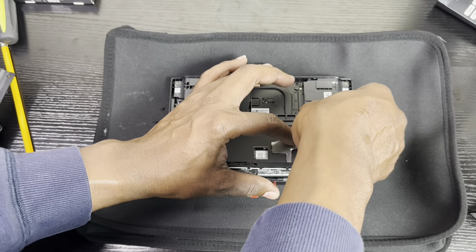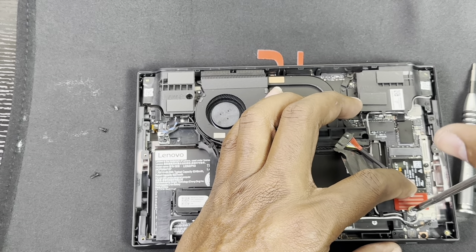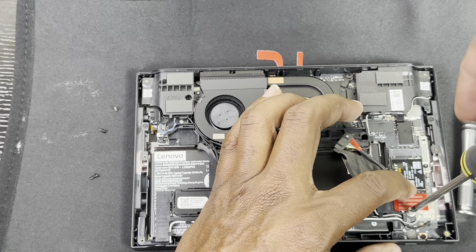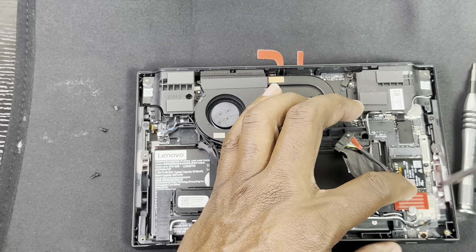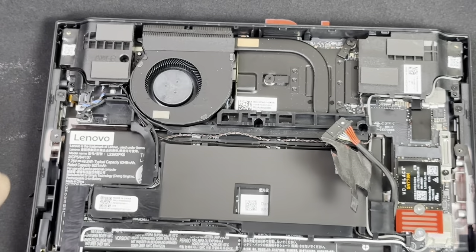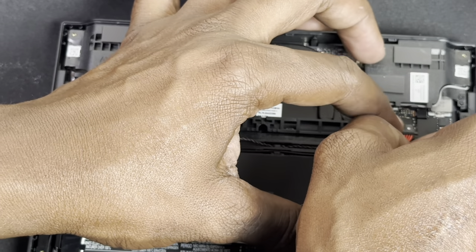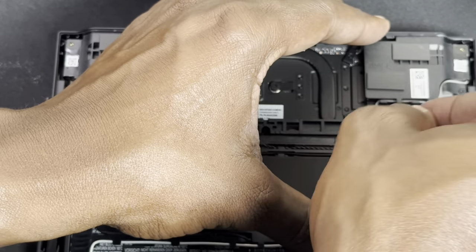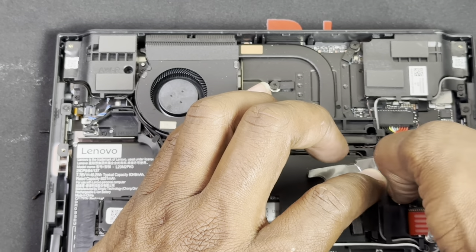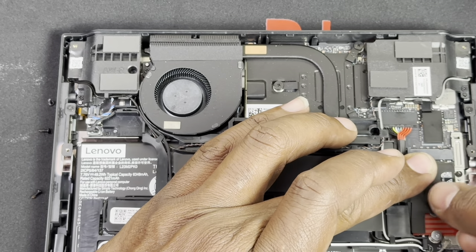Next, disconnect the battery. Now we're going to screw the new SSD down — nice and tight but don't over-tighten, just feed a little bit of torque. Don't over-screw it and mess up the threading. Once installed, connect the battery back into place — it should snap on easily. Slide the power cord back into place, then put the tape back over the SSD nice and neat.